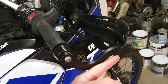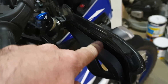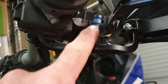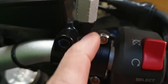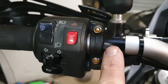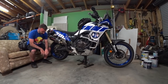In the same vein, those plastic hand guards stop some brush hitting you, but if you come off or you're dragging the bike around, you want something metal here. Bark Busters, or whatever — I quite like these RHK ones because of the way they mount; they come down under the levers and clamp on in here. The only thing I don't like is that the little nuts rust, but you can replace them with stainless. On one side I did have to shuffle the brake lever across about five mil to fit this one in.